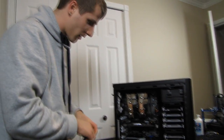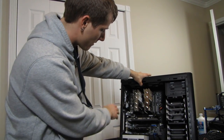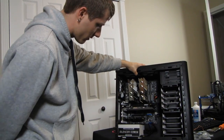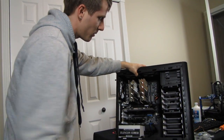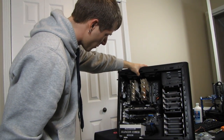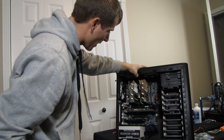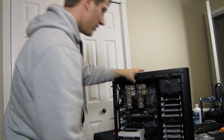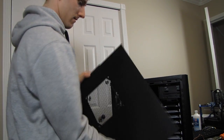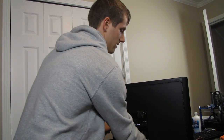Oh yeah, overall specs. So we got a 2600K, 8 gigs of Linus Edition RAM, P67 Gigabyte board, MSI GTX 560 Hawk with the Twin Frozr 3 cooler. We've got a PC Power and Cooling Silencer MK3 modular power supply, OCZ Agility 120 gig SSD, Thermaltake Silver Arrow heatsink. And then obviously all of that is in the Fractal Design Arc Midi mid-tower case.